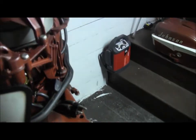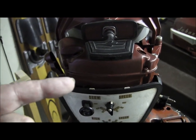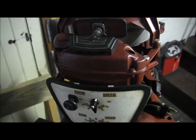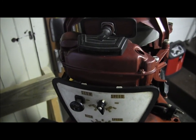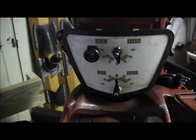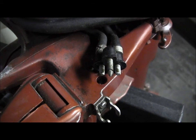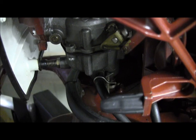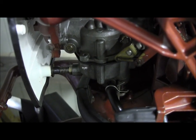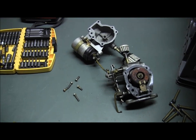The other item which you had in your parts box is right below the recoil — this is called an air silencer. These things do not use air filters because they operate in squeaky clean air on the lake, so no air filters on any of the models I've ever seen. The other item in your parts box is the face plate. Your particular model is the old vintage two-line fuel setup, fed into the very well built flow carburetor.